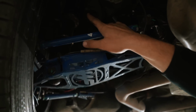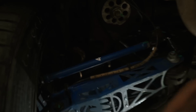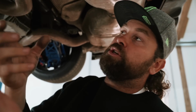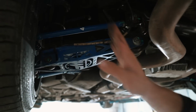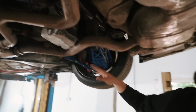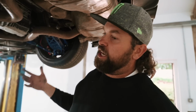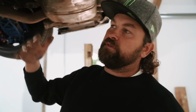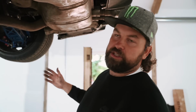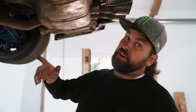and BC coilovers. So we had the BC coilovers on already. They're a true coilover damper, so you can see the coil is actually over the damper tube. Normally in a BMW you have a damper and a spring which goes in here, but these are true coilover dampers. And then yeah, the Wisefab rear kit, which you can see very clearly, is a full kit. Doesn't obviously change the steering geometry like on the front, but it's the equivalent for the rear. It gives you more traction and it gives you better geometry for drifting. The wheel stays straighter for longer, so it gives you better tyre wear and more traction. It looks f***ing cool as well.